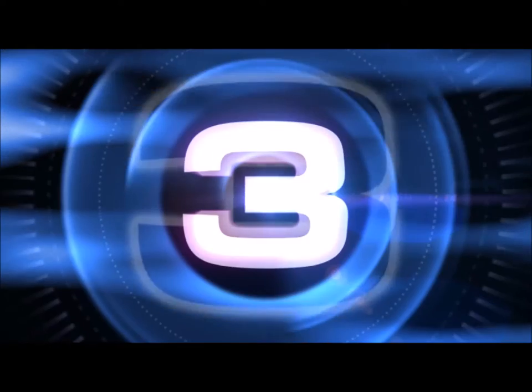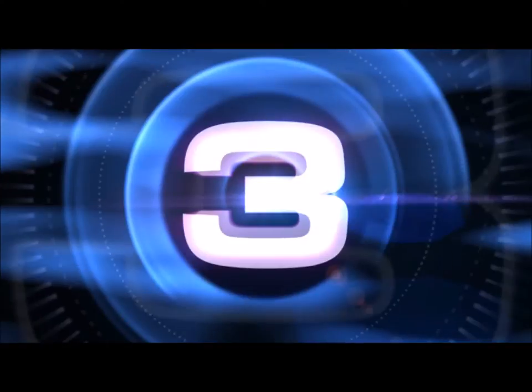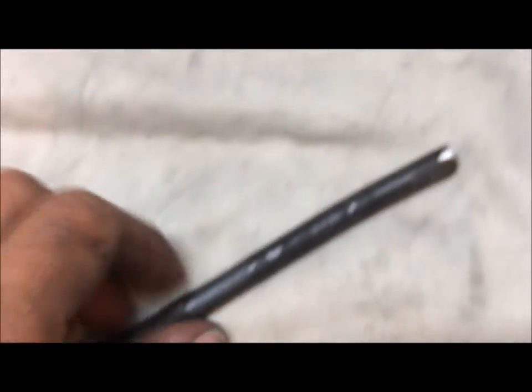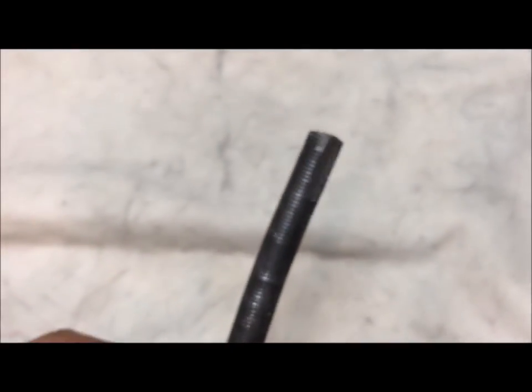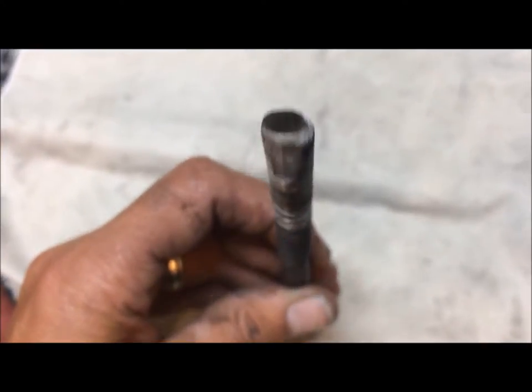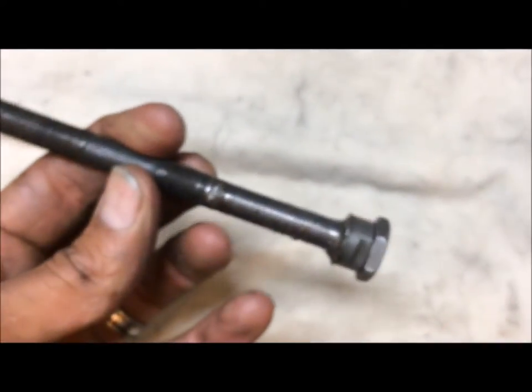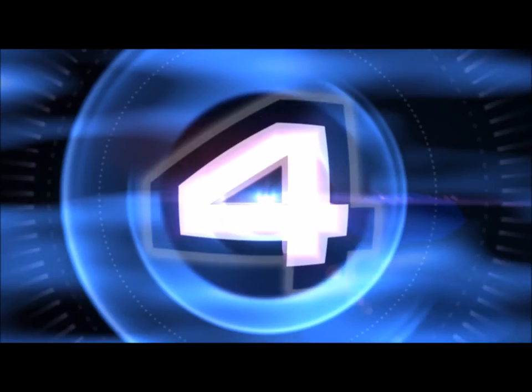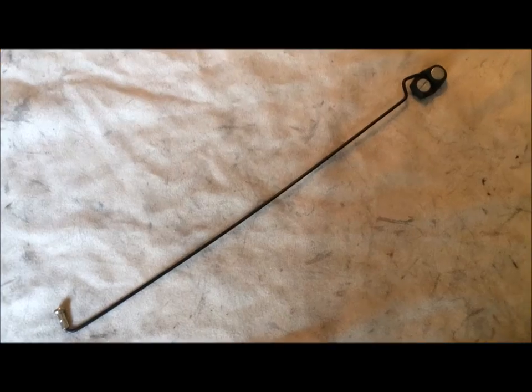Number three is the old ground-down 3/8 axle. You basically bend the end about an inch or so, and grind the edge off at the tip. It's used to knock cartridge bearings out of hubs — when there's just barely enough room to get something on the edge. Sometimes you have to make that edge really sharp, but this is a super handy tool for knocking out cartridge bearings.